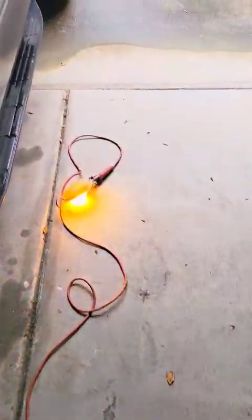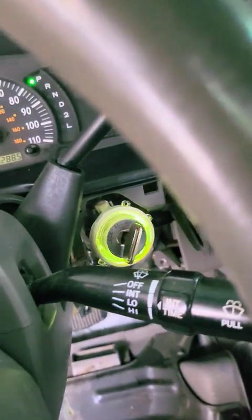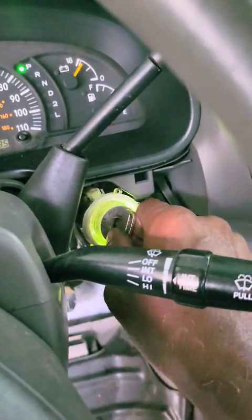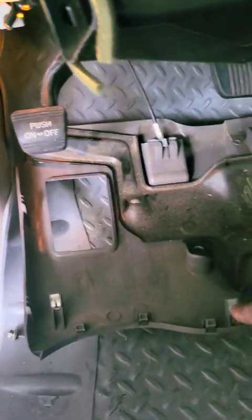Then go back and open your door. Once you open your door, you can see that your lights in the door are on, so you've confirmed the battery is connected on both sides. Now, before you put the cover on, you want to check your ignition switch — you hear that, there are no hangups. Make sure you turn everything back off again and everything is good to go. Then put your cover back on. There are only four bolts and some snaps to put your cover on. So that ends it.